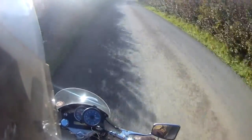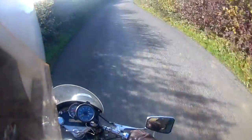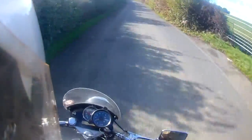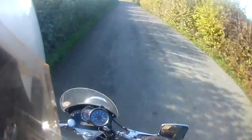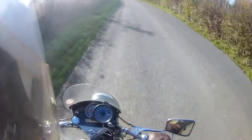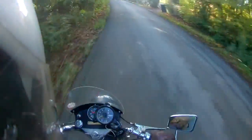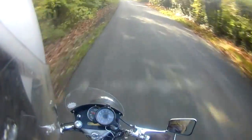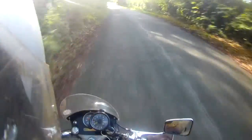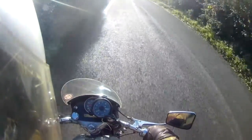It's not exactly comfortable, this bike. Little narrow seat, hard, and you tend to sit on the featherbed frame rather than in it. And your legs are splayed by the width of the cradle frame. Road holding, as you'd expect, is excellent. The twin leading shoe Commando front brake is also very good. So you've got good braking, and it corners and handles beautifully. It's just not that comfortable.